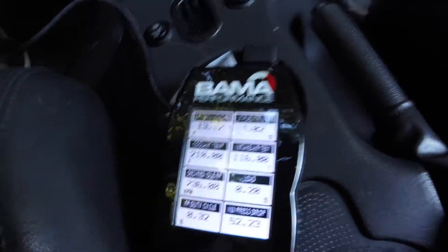I've been sitting here letting my car idle, and the intake air temp is down from what it was before, but that could also be from sitting in the shade compared to the sun before. In conclusion, if you're thinking about wrapping your intake, don't — save your money and put it towards something better. There's really no purpose; your intake air temp is going to go high and you're going to lose horsepower — maybe one or two horsepower. Hopefully you found your answer to whether you should wrap your intake or not.